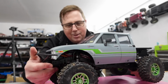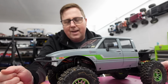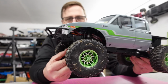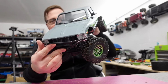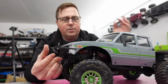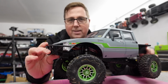So there's the C2X from RC 4-wheel drive. So compared to other Comp 2 rigs or the standard of Comp 2 rigs now, this isn't great. However, it did perform all right on them rocks. It wasn't too bad. They're saying that that servo is a high torque servo. It's not. When I had these wheels over in the rocks like that, it just wouldn't turn at all. It was proper stalling and just completely dead almost. So the servo, definitely not high torque, or not in my opinion anyway, so that is something that will need changing.